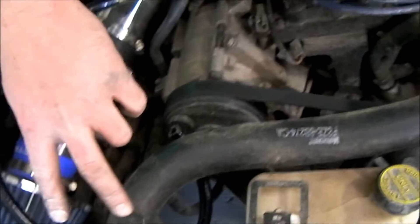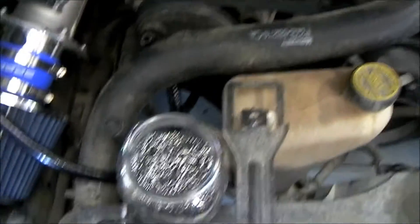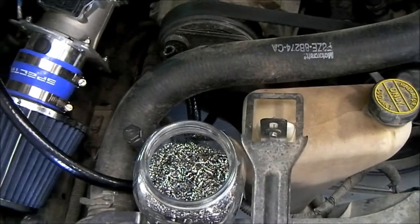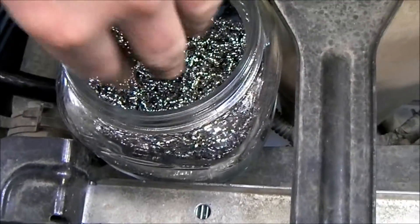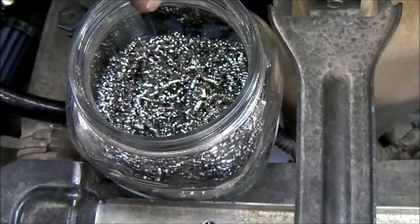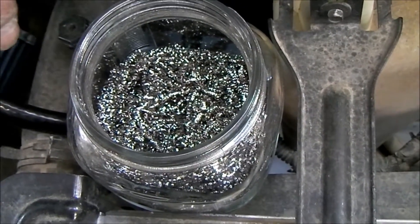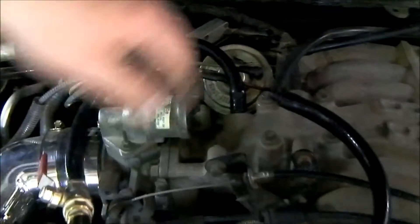On the other line of the canister — we should grab the lid too but it's drying right now, so we shouldn't move it. This line will go into the middle down in there and feed fuel, and this here is to keep the bubbles down. It's got a filter on the bottom of that pipe. Then another line coming off there will go directly into the intake, which will feed fuel vapors into the intake. The other line will just recirculate.